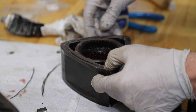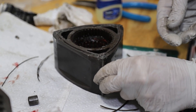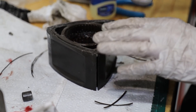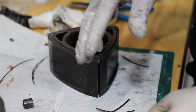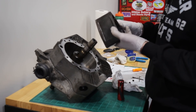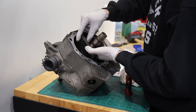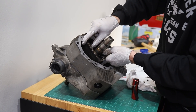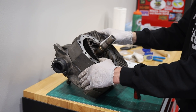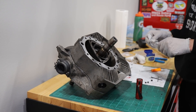All the springs are working really well. Since these are split apex seals, we put the small piece in first. The Vaseline will hold that in place when we put this inside the rotor housing, and then later we can slip in the larger pieces a lot easier. We have our eccentric shaft facing to the right and then that puts this corner facing right at the spark plug. It's kind of nice because the rotor only fits in one way - you don't have to guess or use marks to time or line everything up.